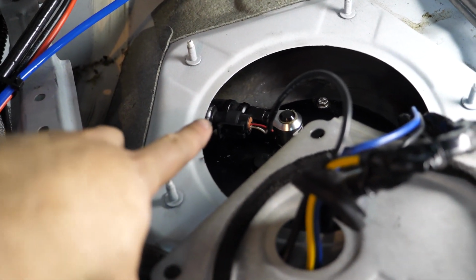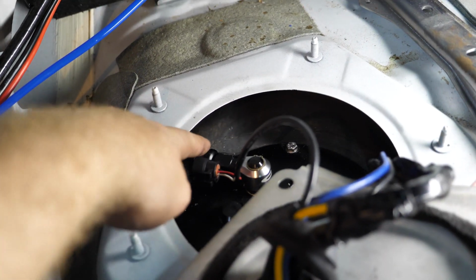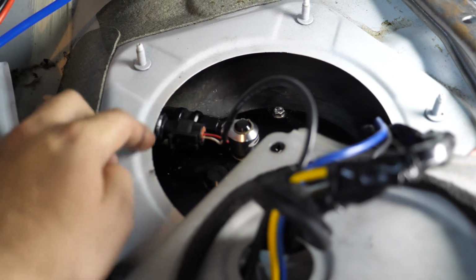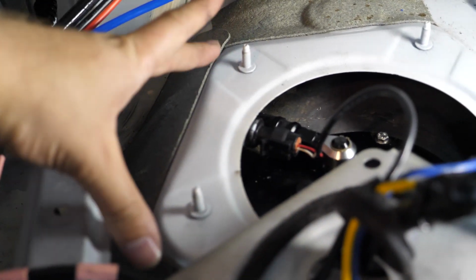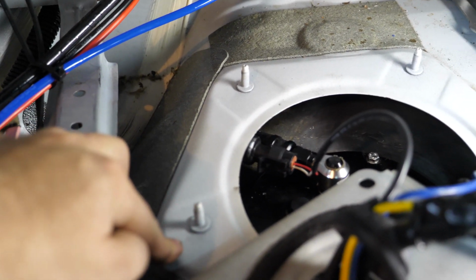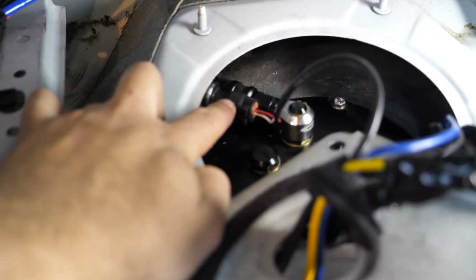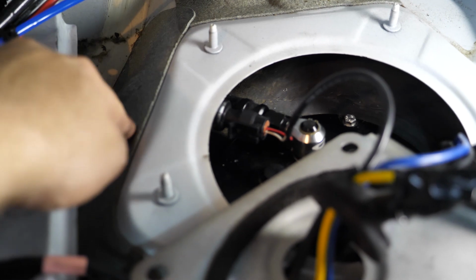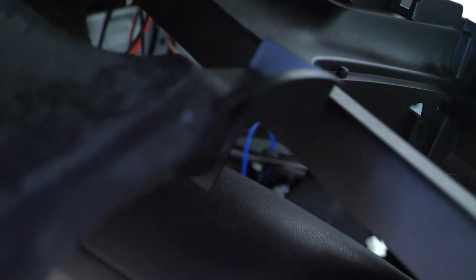But we've got those fittings in place right now on top of the CGM top hat. You can see right here on the back side, this is the barb fitting that connects to that little swivel 6AN joint. And then that really large fitting that includes the check valve and the port sitting underneath the metal is currently connected to the factory fuel line. We've got the wire here for the fuel gauge plugged into that sensor, which is connecting to that fuel port. And then that line is connected and heading all the way over to the driver's side.